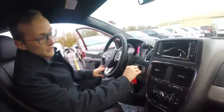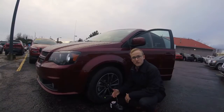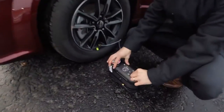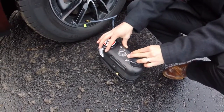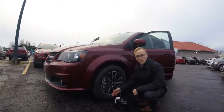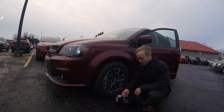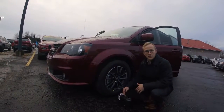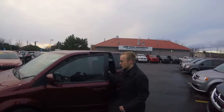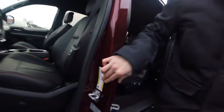Take the adapter and plug it into the outlet in your van, and then all we've got to do is turn it on. The vehicle is on, so now all we have to do is turn the dial from air over to the sealant mode, press power, and it will empty the sealant canister into your tire, filling up the hole that's causing the leak. Then all you have to do is wait for it to fill up to the appropriate PSI listed on your sticker on your vehicle, which is located inside the driver's side door — right in here. For this Grand Caravan it's listed at 36 PSI.